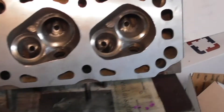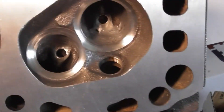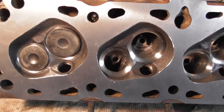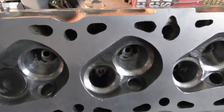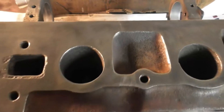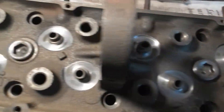Now I've gotten a little further on this Pinto head. Got the intakes ported, bowl blending, exhausts done, just the angle valve job on them. Got two valves in the head for valve spring installation height and guide clearance, and ran into a problem there. The valve springs that he had in the other cylinder head are larger diameter than stock, and the cylinder head needed to be turned down. As you can see, the spring pockets have been opened up to accommodate the larger valve springs.